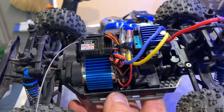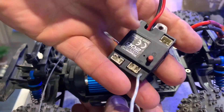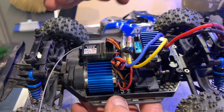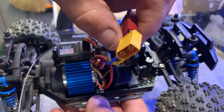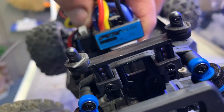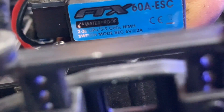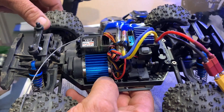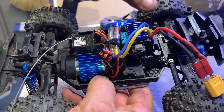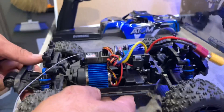So that's it for today. As you can see, what I've done is I've changed out the ESC and put in a Dumbo RC receiver. This was the original two-in-one combo — I've cut the plugs to suit, put all the soldering on them, and that was a conversion plug for the XT60 bigger battery for the 3S. It's a FTX 60-amp ESC 2-3S LiPo. We'll take this for a test run on another day — it's getting pretty dark out where I am. Any questions, just leave a comment. Don't forget to hit that like and hit that subscribe button. Thanks guys for watching and I'll see you in the next one. Bye.